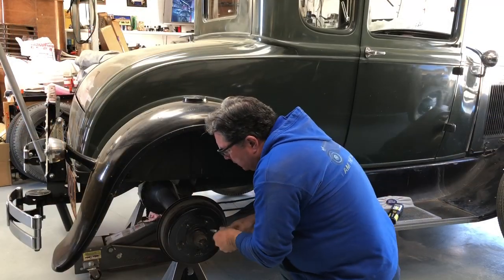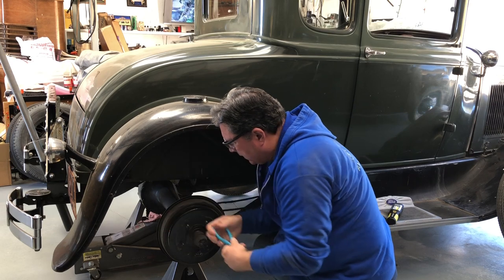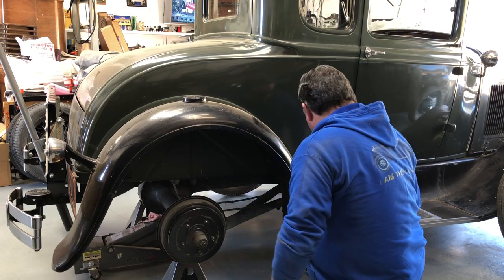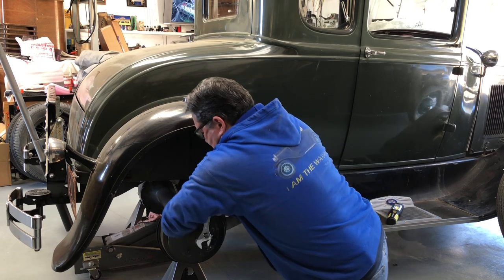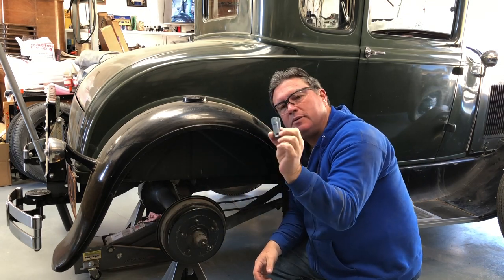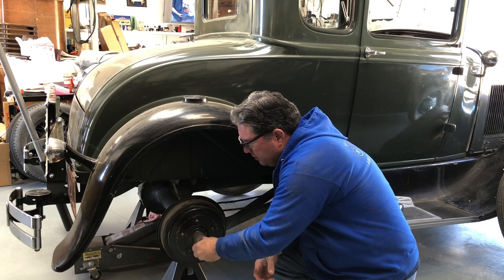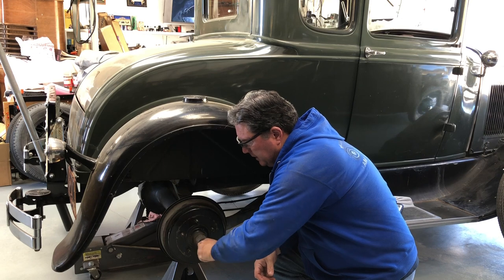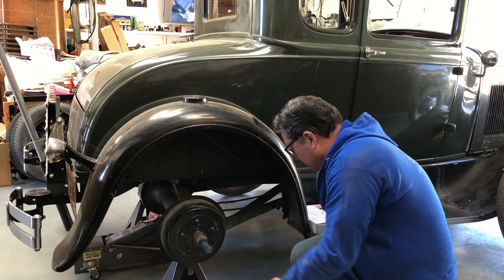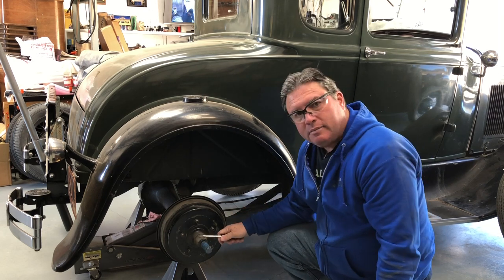The first thing I've got to do is pull these cotter pins, then I'll get to yanking on these hubs. There are a lot of questions from people about how to pull the rear brake drum — I've got a couple of ways I'm going to show you. One way you may have seen me pull hubs in the past is with this neat little tool, which you can still buy at some of the Model A parts vendors. This just threads on to the end of the rear axle. Make sure it bottoms out on the threads — this is to prevent you from damaging the threads. Then the idea is you use a screwdriver to pry the drum away from the backing plate and give it a solid whack, and it breaks the hub loose from the shaft.